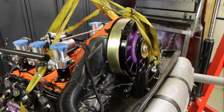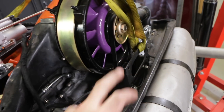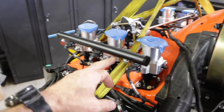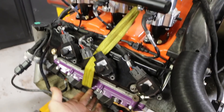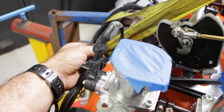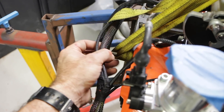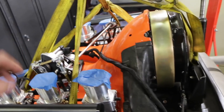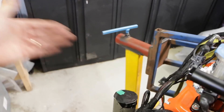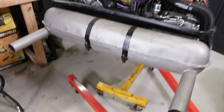There are no really good attachment points on this engine. I've attached it to the frame at the front — that's a nice solid point. Beyond that it's quite difficult. The main weight is being supported by a strap all the way around underneath the engine, and then a strap from the front over the top down to a bolt on the back. I then realized I could attach it to the yoke, since the yoke is staying attached to the engine and is already holding it — that's a much more centered mount. I'll lift the whole engine up, slide the engine stand out leaving the yoke attached, then slide the lift table underneath so we have the engine sitting on the table.